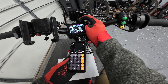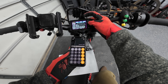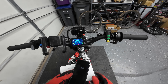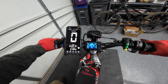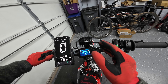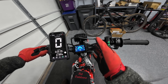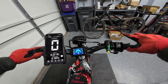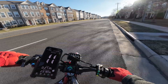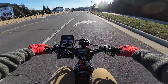If you've never used a Moxin controller before, the middle figure is what you're adjusting to. The right side is the default and the left side is the current setting. Let's get the middle figure up to 773, then I'm going to hold M to save the settings — that's going to completely reboot the controller. Hopefully the speedo is a little bit more accurate. I also want to test out the other features of this controller, such as the reverse function and wheelie mode. But to test out the wheelie assist functions on a Moxin controller, your battery charge must be at least four volts below full to make space for the controller to charge the battery back up under regen. The speedometer is now reading dead accurate — it's showing 23 when we're going 23, so I don't even think I need to adjust it at all.